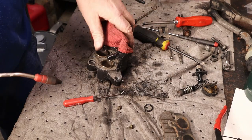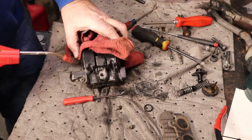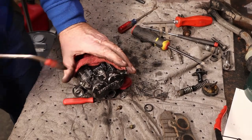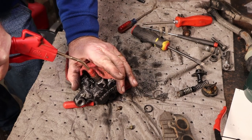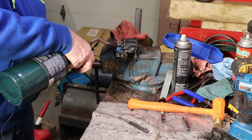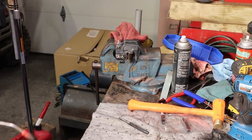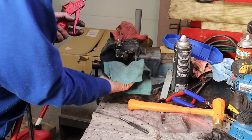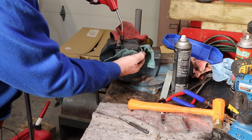We got the air compressor pumped up a ways. I've also taken the rest of the rubber stuff off this thing and taken it off the bracket. Added a little heat to it, and we're going to apply some pressure to this and see if one of the pistons will pop out. Those pistons are fairly stuck. She's bubbling brake fluid so it must be getting hotter. I don't want to launch a piston out across the shop — this is a bit awkward.